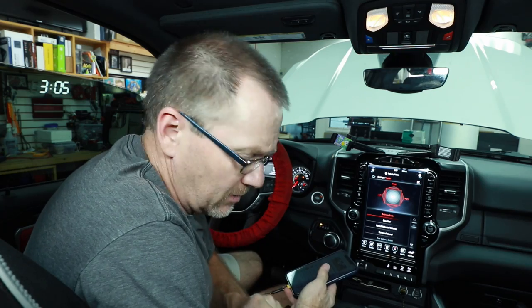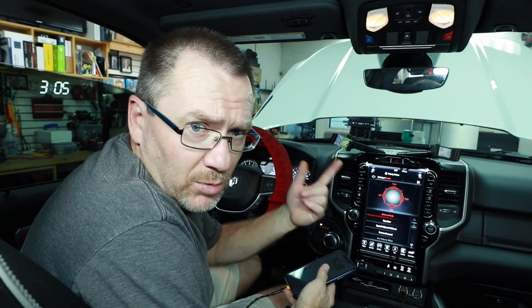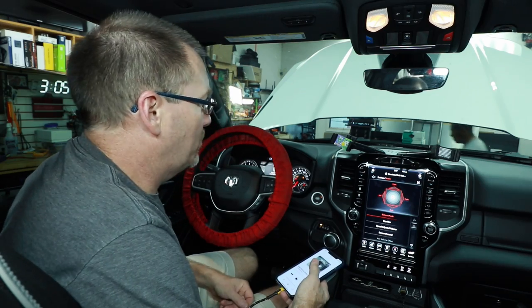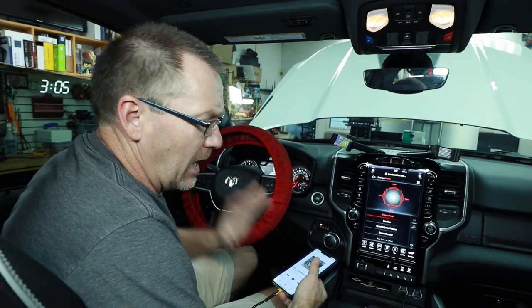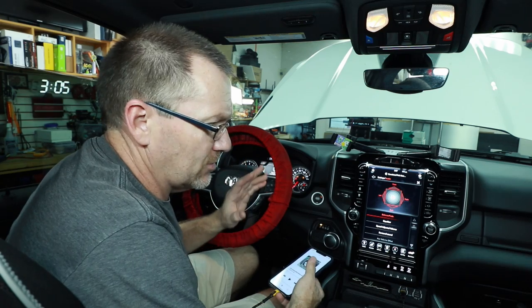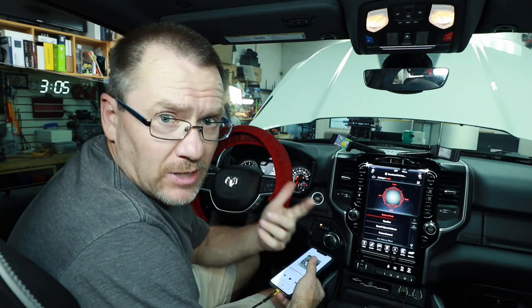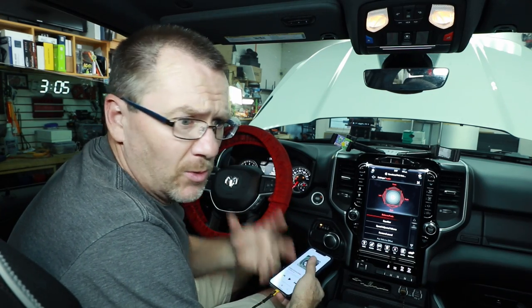Driver's side checks out; he'll check the rears. The whole purpose of polarity testing is to make sure the speakers are moving in the directions you anticipated. In some cases the dash speakers may need to be reversed from the door speakers, or the whole system might need to be flipped so you don't get echo in the Bluetooth. You just want to make sure what you planned is actually happening. In this case all speakers popped the direction we had hoped — most of the time it doesn't go this smooth. There are a lot of connections that can get reversed: an RCA can get switched.